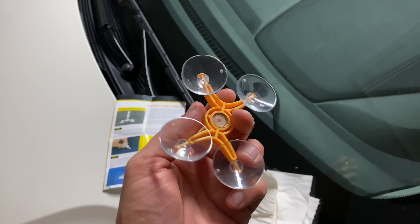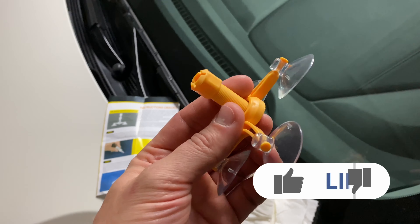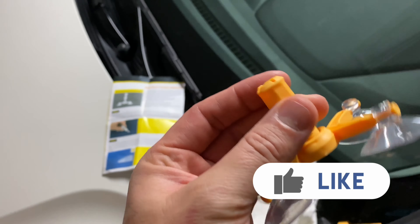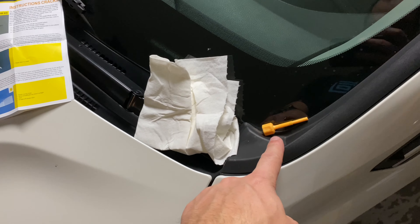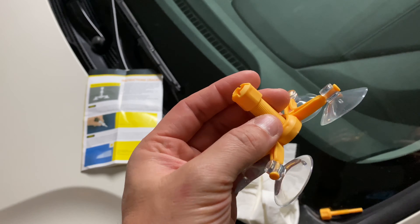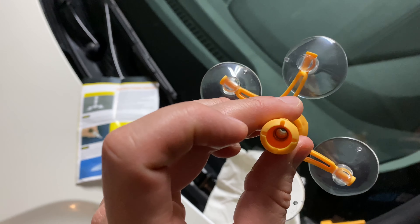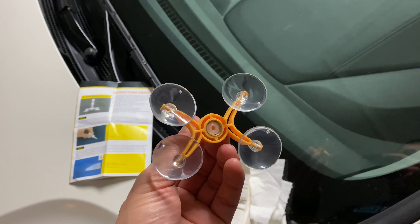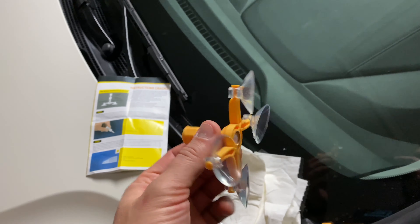This is the kit that I bought. It's the one you suction onto your glass, and there's an inner chamber that you screw onto the glass. Inside there's another piece — basically you screw it right in there and it applies pressure. Once you have this set up, you put some resin in there — a few drops — then you apply the pressure tube inside and wait about five minutes, and hopefully that will fix it.